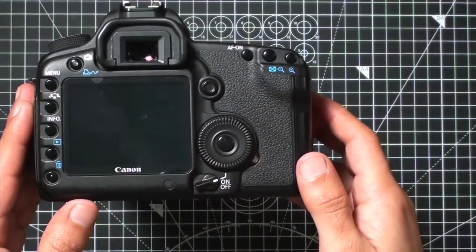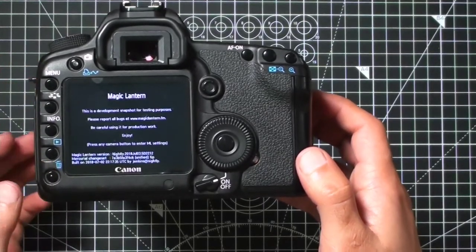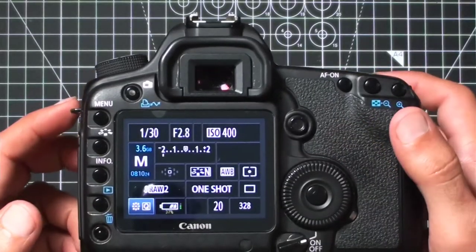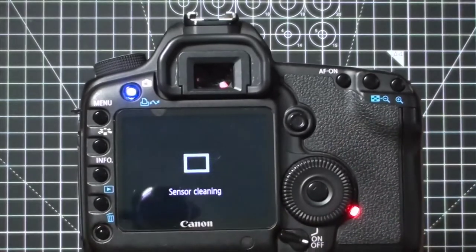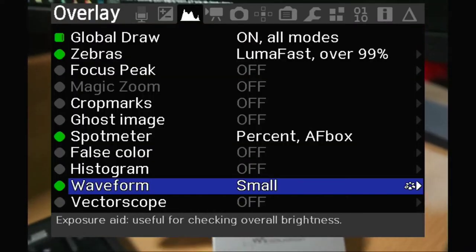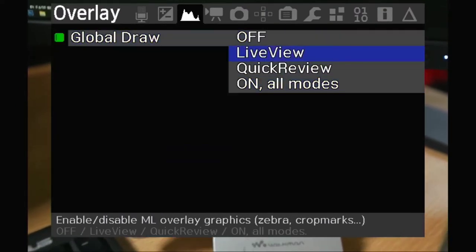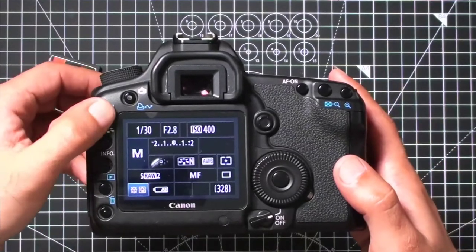Now I have Magic Lantern installed and running on my DSLR. To get into it, press the delete button and it goes into the Magic Lantern menu, then use your scroll wheels as normal to navigate. These are all additional menus I didn't have before. The firmware now says 2.1 with additional information — before it just said 2.1. I've put in my HDMI cable and here you can see the Magic Lantern menus are showing on screen. We need to get rid of those menus. Go along the top to the overlay option and where it says global draw, turn that off. That'll turn off all the on-screen menus.